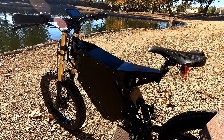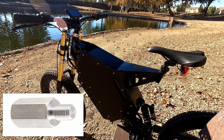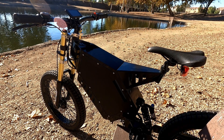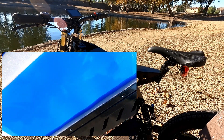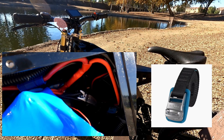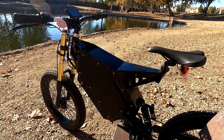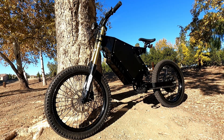What I did was install some shorter standoffs — quarter inch — and went with low-profile bolts for the seat mount. That enabled me to tuck the controller up into the frame a little more, giving me more clearance between the battery and the controller. Now I was able to get some nice thick foam in there, and RC car style I went ahead and bolted in a strap. I don't have the strap very tight — just enough to pull the battery down into the foam. I did a little test ride and it's nice and quiet, seems solid.